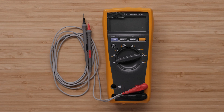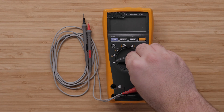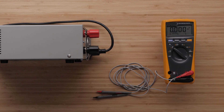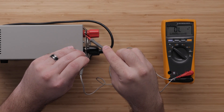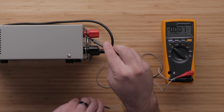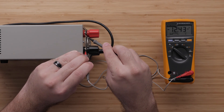For this test, we will need to set the multimeter up. Every multimeter will vary — refer to the manual for specifics for that unit. We will want to test for DC voltage. The symbol for this is a V with a straight horizontal line with a dotted horizontal line below it. Now take the red lead and connect it to the positive power connection, then take the black lead and connect it to the negative power connection. Don't worry about accidentally doing this backwards — it won't damage the equipment, but will show a negative voltage reading. Simply swap the leads around for a correct positive reading.